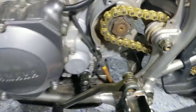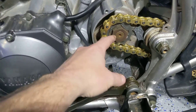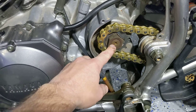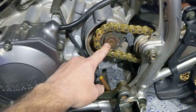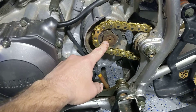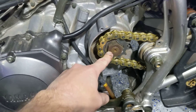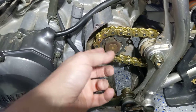The front sprocket is pretty specific. Some guys will just impact wrench it on tight and put the lock washer, but you've got to be careful. The threads on the output shaft on the transmission are very fine threads — you can strip them out fairly easily if you're knocking the hell out of it with an impact. So I did it to spec, which is about 55 foot-pounds from all the research I found. Then you fold the lock washer over it so the nut can't back off.